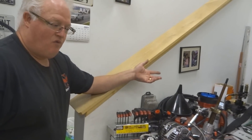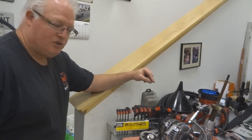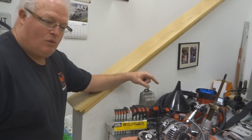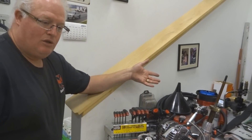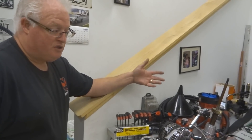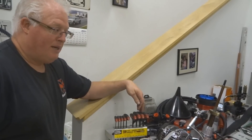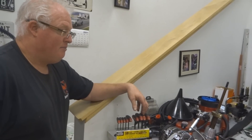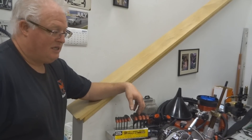We've had pretty cold plugs — we haven't really gotten any heat in them, most have gone down to the ground strap but we haven't gotten heat in the base of the plug yet. Just getting heat in the plugs alone is going to make a big difference in power. We've been leaning the motor out slowly to get it more responsive and where we want it. The motor will make 2,500 horsepower when everything's dialed in right — no shortcuts, no Mickey Mouse, everything's done right.